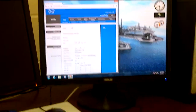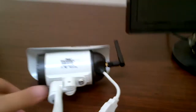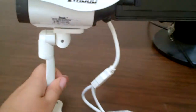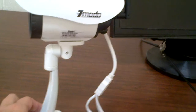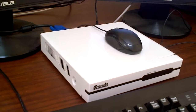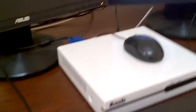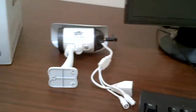One thing — if you haven't even started yet — one thing to know that will make life easier: I highly recommend setting up the cameras first. Before you network through the NVR, get all of your cameras connected and talking to your router, either hardwired or wireless, whatever is your preference, before you even tinker with the NVR whatsoever. There are some settings you can change in the NVR where, if you change them before you connect your cameras, it makes it harder for the NVR to find the cameras later on. So let's start with the cameras first.